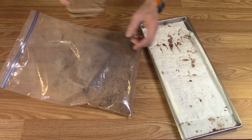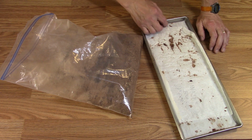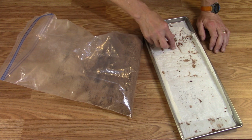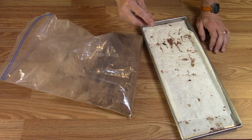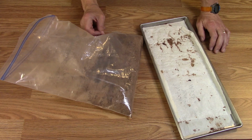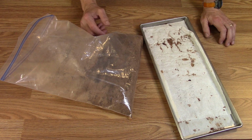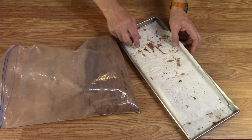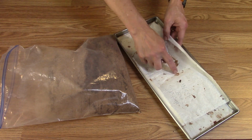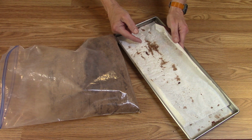And it was in part of the cycle that was just the beginning of the final dry cycle, and the tray heaters were on. So, when it resumed, the tray heaters were on. And by that time, the things on the trays were beginning to thaw. It was up to about 30 degrees Fahrenheit. It was way too warm to be freeze drying, but it resumed the cycle where it left off and turned the tray heaters on before it had a chance to refreeze. And it melted any of the ice still in the drinks. For longer power outages like this, I probably would have been better off if I had canceled the drying and restarted it from the beginning with a short cycle time.